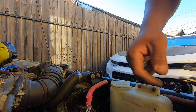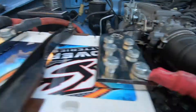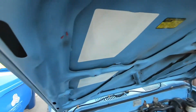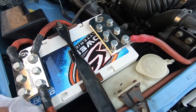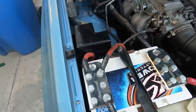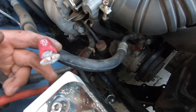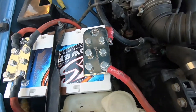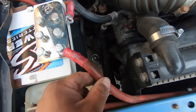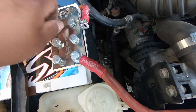Let me go ahead and do the rest of these cables. So we threw the cables on here and we did a quick test again. We put some grease on here. We have some right here and very little — we're good. That's the ground side and that's at its highest point, so we should be good. Now we have to throw the starter one on — the power side — and we should be good to go. This is the alternator. By the way, we used 2-gauge welding wire, as you guys saw in the previous video. So that's where we're running for the power side on this truck.